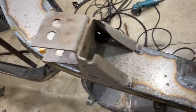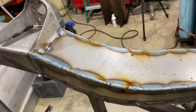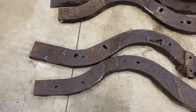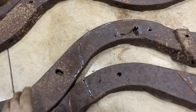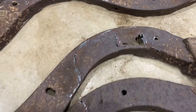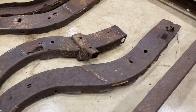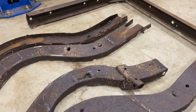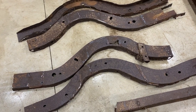You can see where I welded the old frame to the new frame, and I welded up all of the edges of these rear arches that I made. Here are all of the frame rails that I've replaced and built new. You can see these things are trash — super rusty and rotted out, especially on the bottom side. There are holes in various spots, super thin metal, really crunchy. This one folds up like a piece of paper. The whole thing is a mess, so I'm glad I have all new metal.